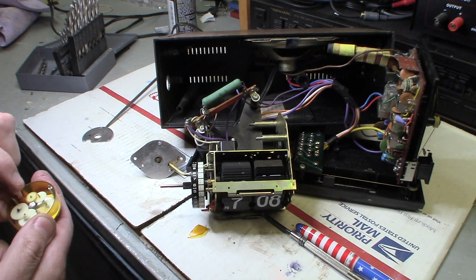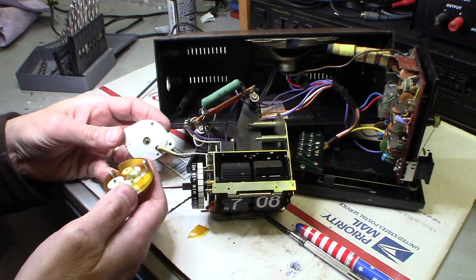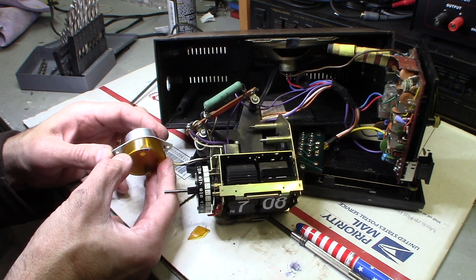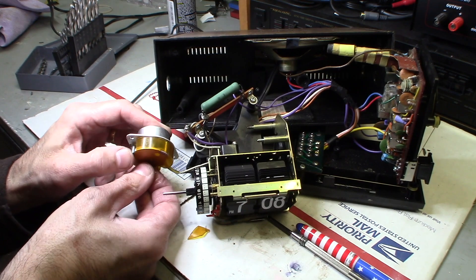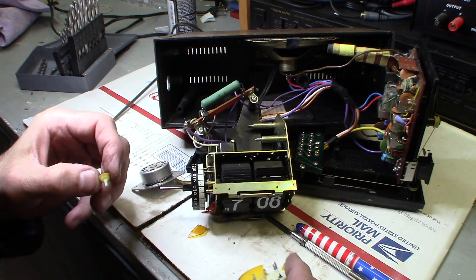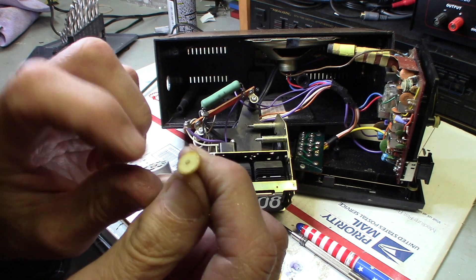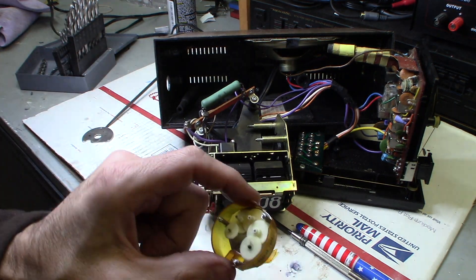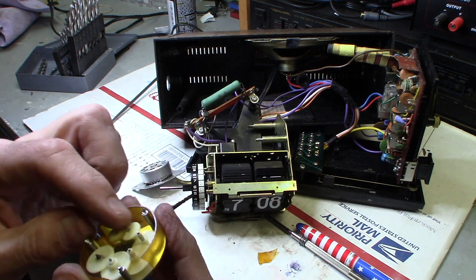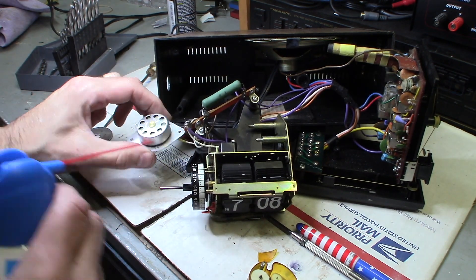So this is the problem right there — that one little tiny gear that I'm showing you. It's worn out, stripped, shrunk — dead. That's the problem with the intermittent behavior: the gear wouldn't sit on top of the other gear and wouldn't drive the gear train, so it would just intermittently work and stop. That little tiny gear is junk. The rest of the gears are fine, so I'll sell those other gears — I'd put them together as a flip clock gear package and sell them for maybe $15 because you can't get those gears anywhere.